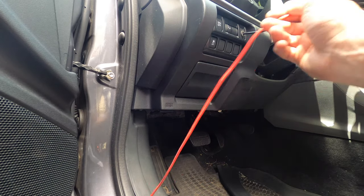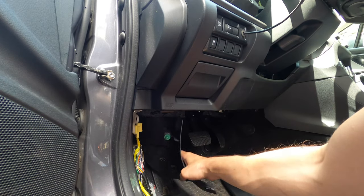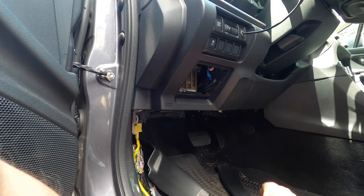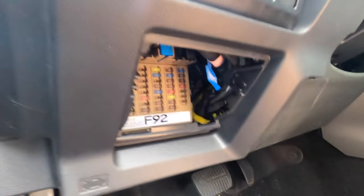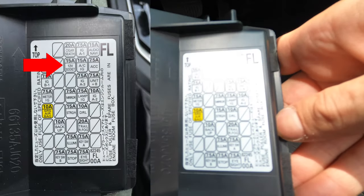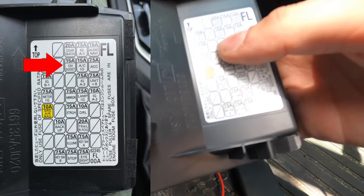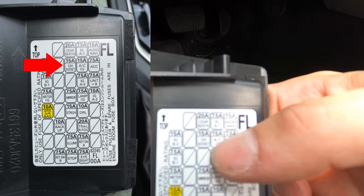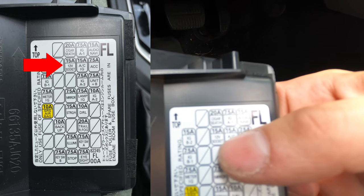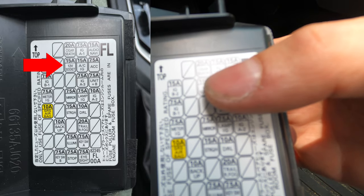So now with the wire completely run, we're going to attach it to our fuse. Pop off this panel and pull down the fuse box, giving us access to our fuse panel. Now if we look at the fuse panel, we can find out which fuse we want to use. I'm going to use the existing 12-volt socket fuse — it's that one right there, and that's the correct amperage we need. So this is going to make the perfect fuse to tap.